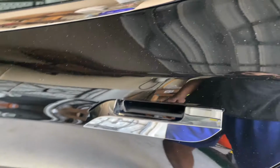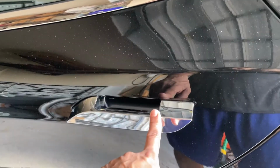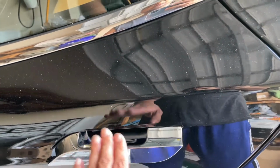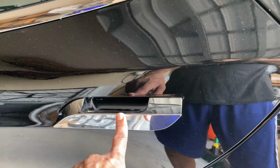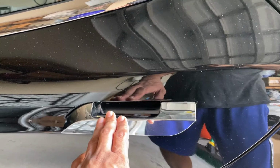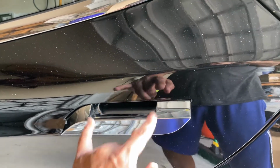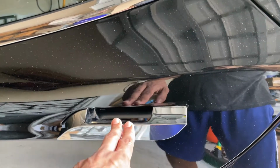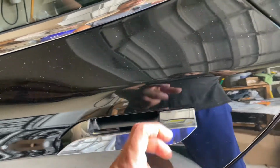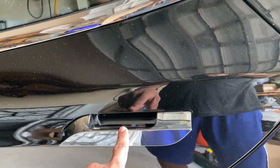One thing I do want you guys to know is that in the Model S, there are different revisions of the hardware. That's how Tesla does their stuff. The very early version was 1.0. Then they came up with 1.5, where they made some improvement, because 1.0 had a lot of micro switch failures. That also had its own issues: there were gears that were failing. Then they came up with 2.0.